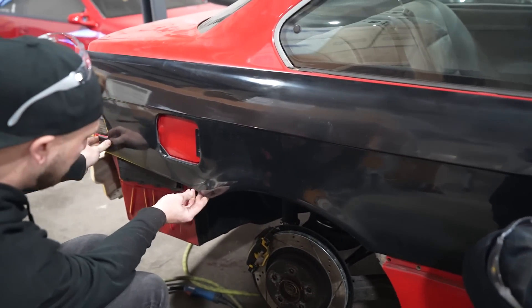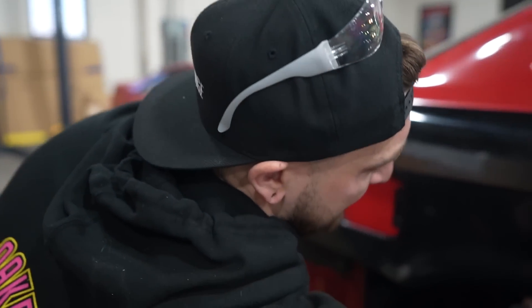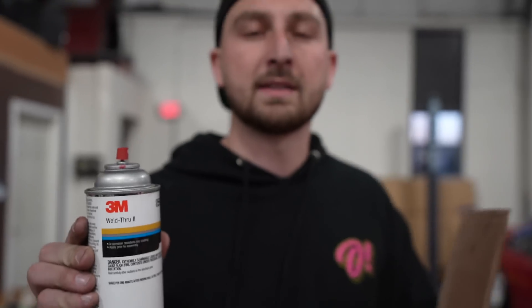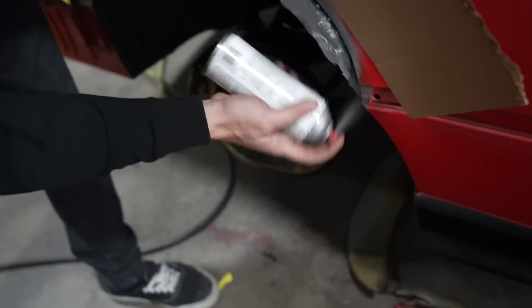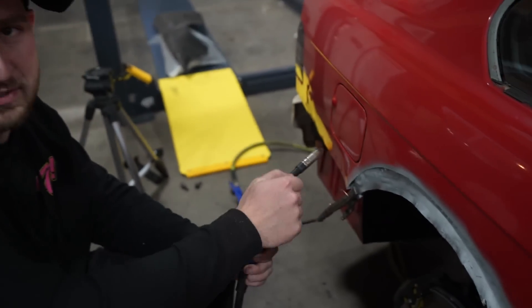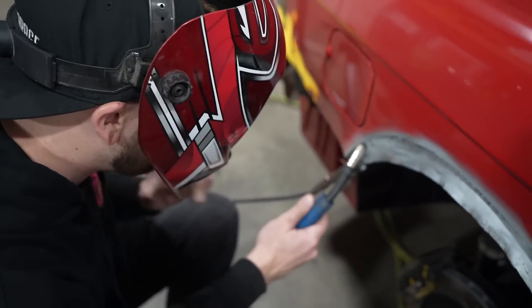It's cut back perfectly right here - right where I want it to be. We are good to go. So we got the surface all cleaned up and ready for some welds, but if we were to seal it up now there'd be a bunch of bare metal inside and if moisture gets in it's going to rust. So we're going to seal it with some weld-through primer - this will get primer on it but we can still weld through it, unlike normal paint. We're going to start from one corner: weld, bash, weld, bash, weld, bash, repeat until it's all sealed up.